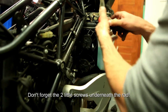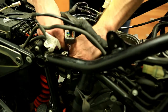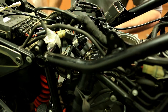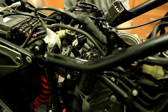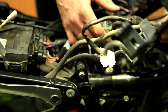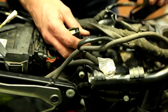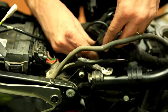Fit the two little screws for that plastic cover — one at the top and one on the other side. Once you have your spark plugs refitted on the rear cylinder, you can start putting back the plate. It's a little bit tricky with all those cables and not a lot of space, so take your time. Make sure all the connectors go in the right way — they're all foolproof, so you shouldn't have any problem. Just make sure they're all connected.